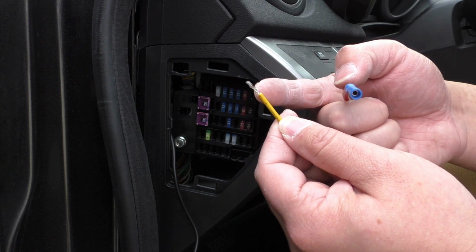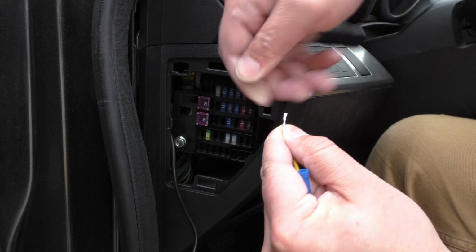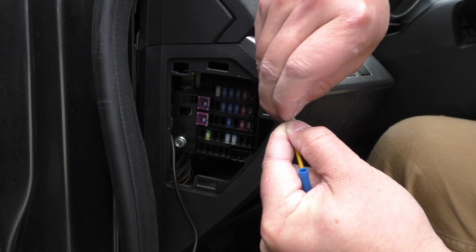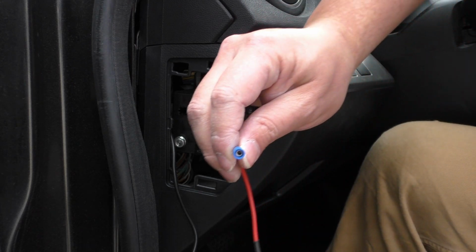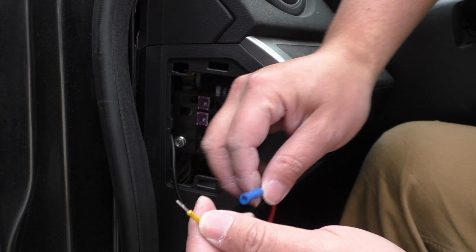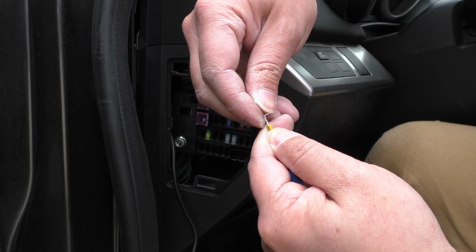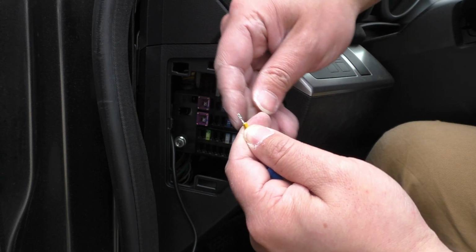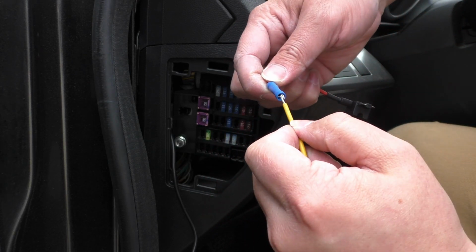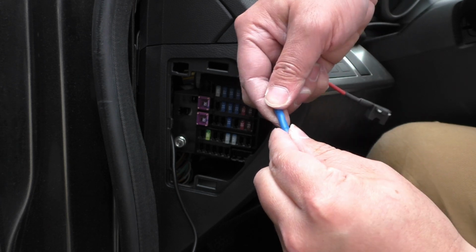First, you take the little heat shrink cap off of there, and then I like to twist the wire element so it's nice and rigid and stays together a little bit better. If you look in here, you can see there's a little metal cylinder, so we're going to insert this lead in there. I actually like to bend the end of the lead back on itself, giving it a little more thickness than it originally had, just so that we can ensure it gets clamped. Then we'll stick the wire into that cylinder.